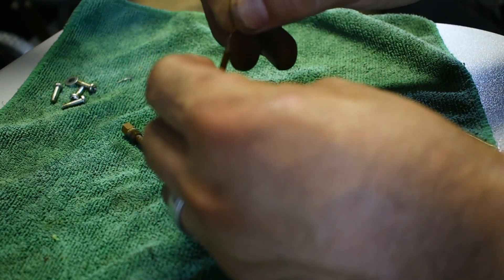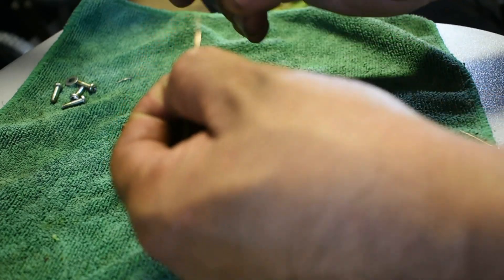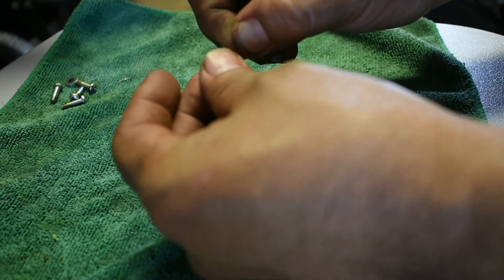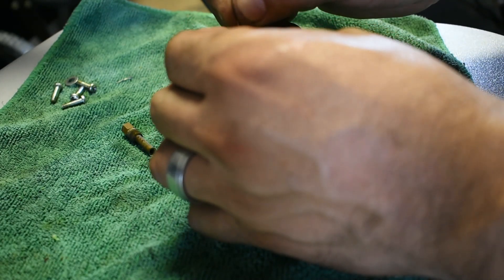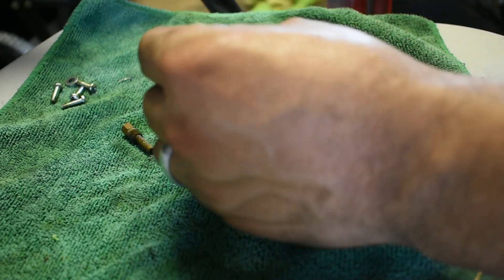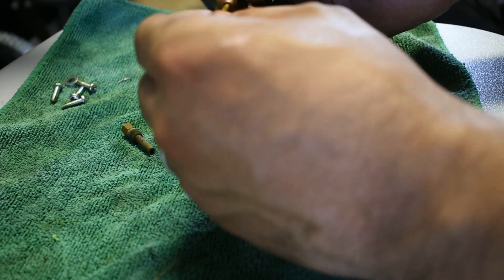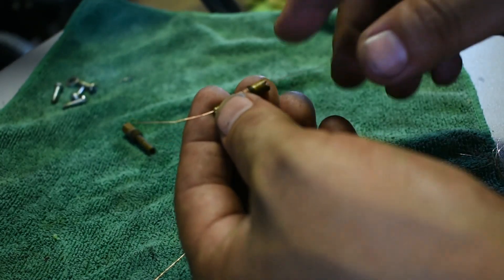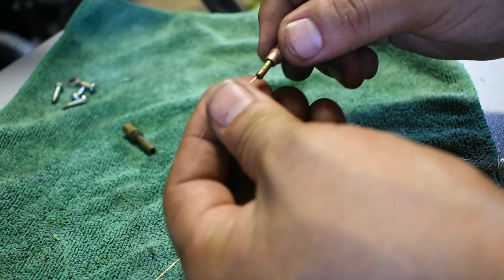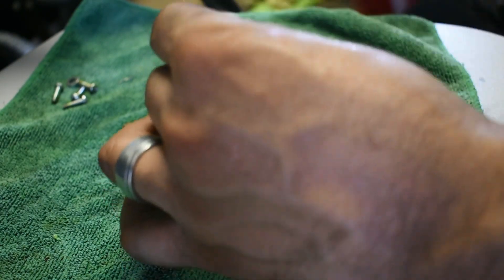It's pushing — I can feel this thing is super clogged. I can feel the little wire stuck there, it can't go through. This part is going to need a lot of cleaning. You should be able to pass the wire through the jet. There you go — we got the wire through the jet. Then just move it back and forth, so all that debris inside the jet is gone. Just keep doing that.